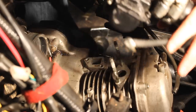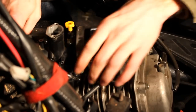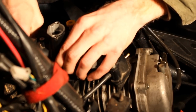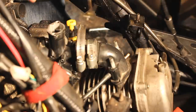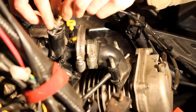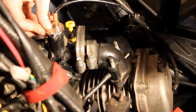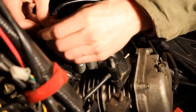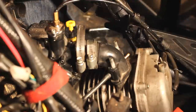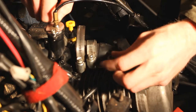In reverse order, take your intake manifold back and put it on, and replace the two bolts here and on the air box. Replace your slide — make sure when you're putting your slide back in, there's a curved side and a flat side. If you have a top-side carb with the stock carburetor, you do not have to remove the slide. You can just pull out the throttle cable like so. And replace these two bolts.